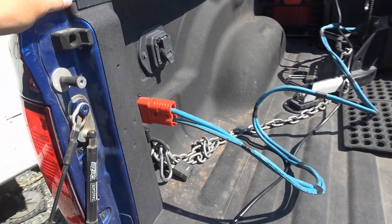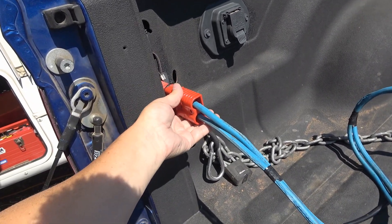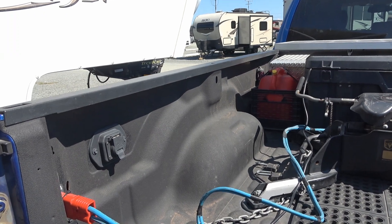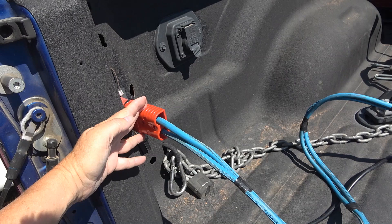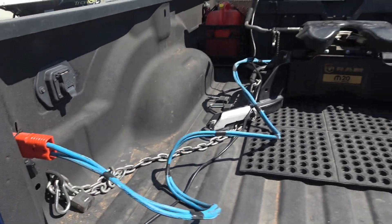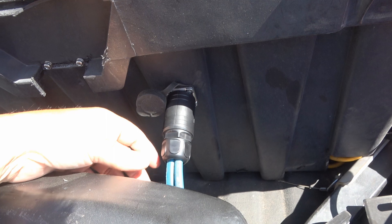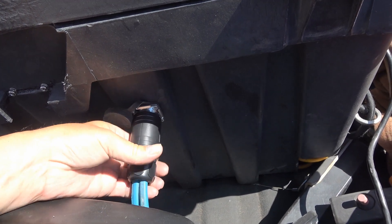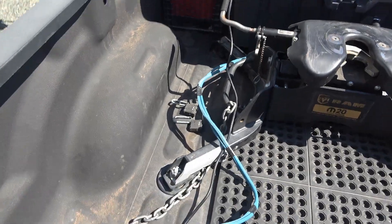Now I'll show the DC-to-DC charger hookup. This port here was installed when I had a DC-to-DC charger in my camper - it's got those PowerPole connectors and it's wired to the battery with a 60-amp fuse protecting the wiring, plus a switch to turn it on and off. It gets the alternator or truck battery power back to here. I made up this cable out of old jumper cables, cut them, and added the connector. It uses that truckers-style DC connector - just goes in like that, nice and weatherproof, like they use on big rigs. I just click it in and I can drive the truck and put 40 amps of juice into the battery bank.